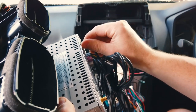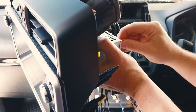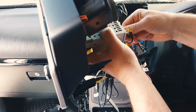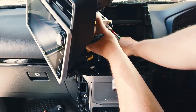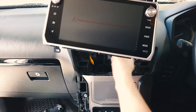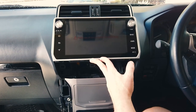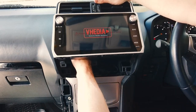These plugs can only go in where they fit, but check you put them in the right spots as they could fit into a smaller hole. Screw on the WiFi antenna hand-tight on one side and the GPS on the other. Connect the main plug and push all the wires back in behind the unit. Hold it in position and do another test before fully seating it — you don't want to have forgotten something, and it's handy to get it right the first time.